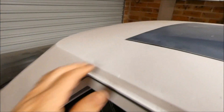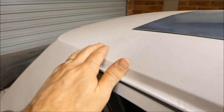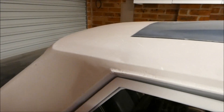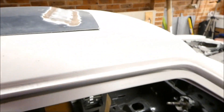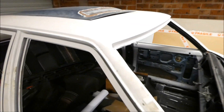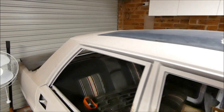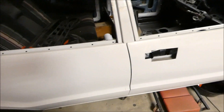I need it for the roof because I've got some dents up there that I don't have access to the back of. I can't get any tool into that area - I haven't got a spoon or pry-bar type dolly yet. I'll try the EasyBeat to pop those dents out and start getting the roof nice, straight and solid. I'll start with the roof because it's the longest panel and part of the shell - it doesn't move, it doesn't need adjustment, it just needs to be straight. Then I'll move on to the quarters and surrounding shell areas before tackling the hanging panels.